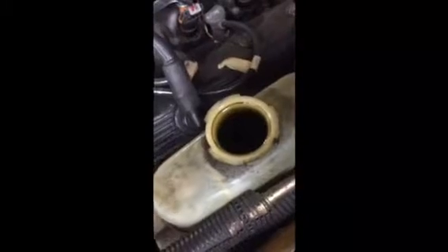So you go to the master cylinder and take the cap off so it can release air when you press the piston in. This is showing full now because I pressed the other side and it came up — it will probably drip out, so please put a towel if you want to be clean and neat. We got to get something to press this in so it will fit over that. This is a C-clamp — we got it on the back and on the front on a piece of wood. When we turn this, that's going to squeeze the piston in, and that's going to push fluid back up here.